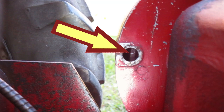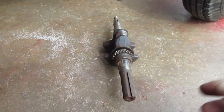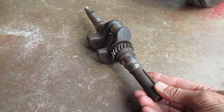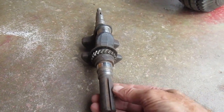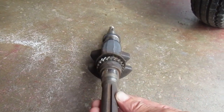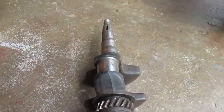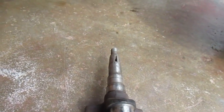So those two lines almost line up. Now I want to look at the lines on the flywheel and see what's there. This is a crankshaft out of a four horsepower Kohler — you can see the key slot lines up with the crank throw where the rod's connected. So when that key slot's pointed straight up, the piston will be at top dead center.